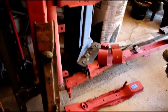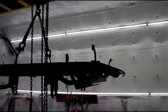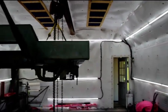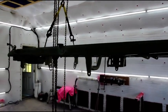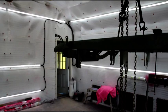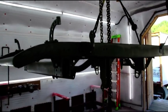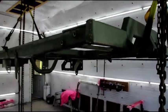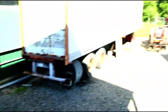We've got some more things going on — I'll take you in the booth and then we'll take a look at the snowblower Jeep out in the sun. Got another frame hanging from the beam in the paint booth. This is nothing special, just a Model A hot rod frame — got to get it in some hot rod black. I gave it a good wash down with some wax and grease remover. That's drying right now and we'll give it a squirt in about an hour. Perfect day — no humidity, nice warm weather.